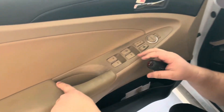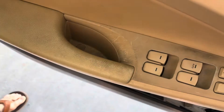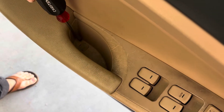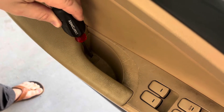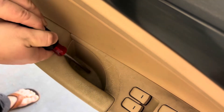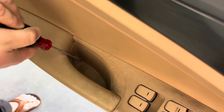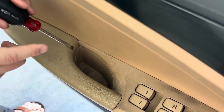Look down inside the door — there at the end of my screwdriver there's a latch or a flap in there. You've got to get your flathead screwdriver in there and pry that up. I need one that's not so wide to get down in there. I'll get a smaller flathead to flip that up and undo that screw. There we go — I felt it come up.